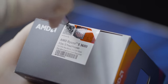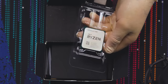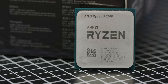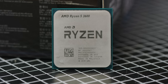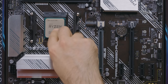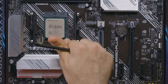Always open your CPU box carefully. AMD's Ryzen 5 3600 features six Zen 2 cores at up to 4.2 GHz boost, and we'd hate for you to damage them. For AMD CPUs, the lettering always matches right-side up with the logo on the socket. Alternatively, you can match the golden triangle with your board to make sure it seats properly. When you're ready, gently press it into place. Give it a wiggle to make sure it went all the way in, then close and lock the latch. This last part can be a little scary, but as long as you follow our instructions, it'll be okay.